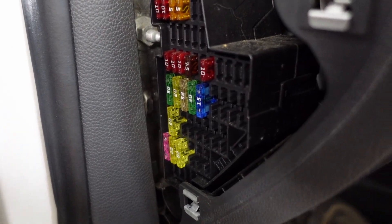Check your fuses and you might be able to find a fuse that's burnt out. The fuse is F19 in the engine bay fuse box - not even the one I just showed you - and that's the one you want to check to see if it's popped.